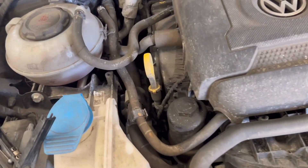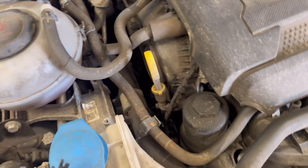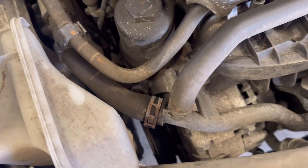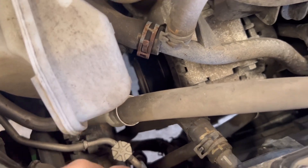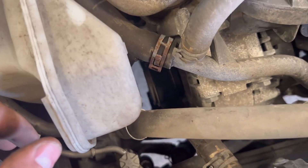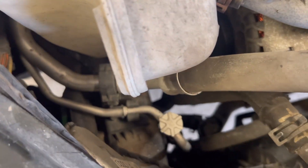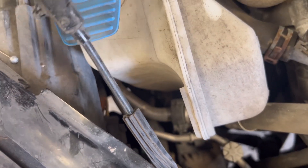So we're back. Obviously you saw the handle was loose inside. I've managed to get underneath and this is what we have to do — you have to take the under tray off and undo the bonnet manually, which means getting hold of this cable here and pulling it. I'll show you what's happened now.